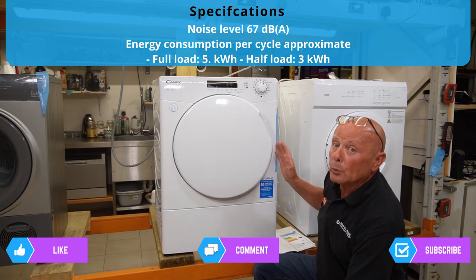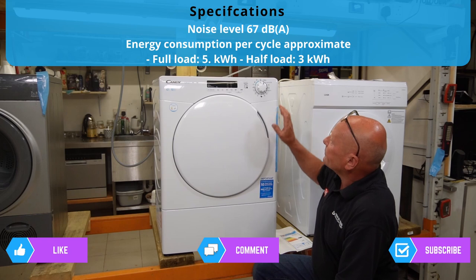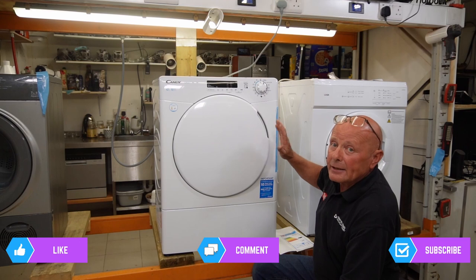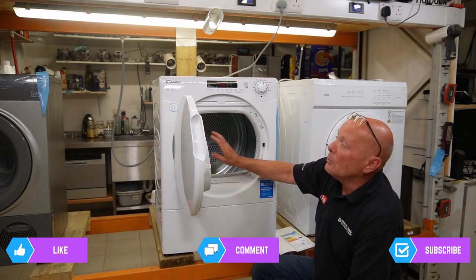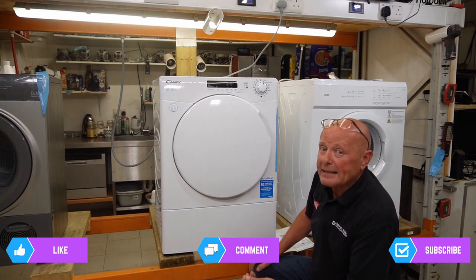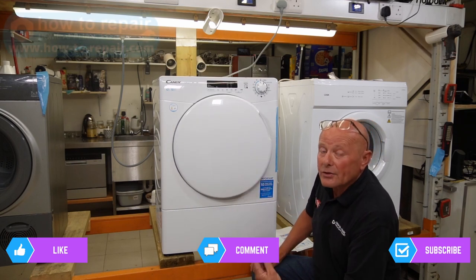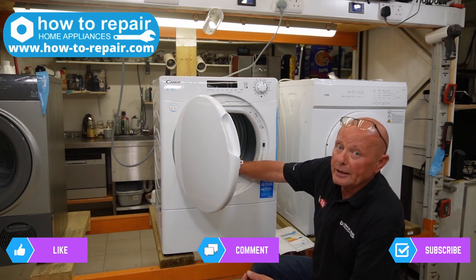The important things to remember with all vented tumble dryers — and this will prolong the life of the machine no end. If you set the machine for a two-hour or one-and-a-half-hour cycle, make sure you do not interrupt the cycle by opening the door to check if the clothing is dry. When you open the door you cut off the air supply going over the heater, and although electricity is disconnected from the heater, the airflow is shut off immediately. This can cause safety cutout stats to blow, especially when opening and shutting the door repeatedly.